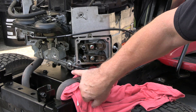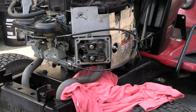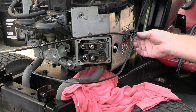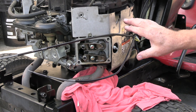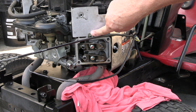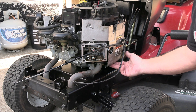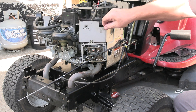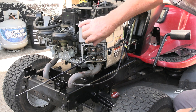I'm going to use a Torx T25 to break that loose. I'm going to go up here on the top and break that one loose as well — get them out of my way because I'm going to be working in this area right here. I've got them in a little holder. I'm going to take this plate off and just leave everything connected. This plate is held on with a 3/8ths bolt, and the bolt up under here is an 8mm. I'll put this bolt back to hold it in place while I get the bottom bolt out, then remove this bolt and this should fall backwards.